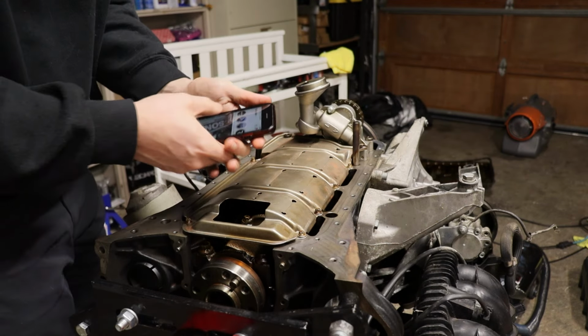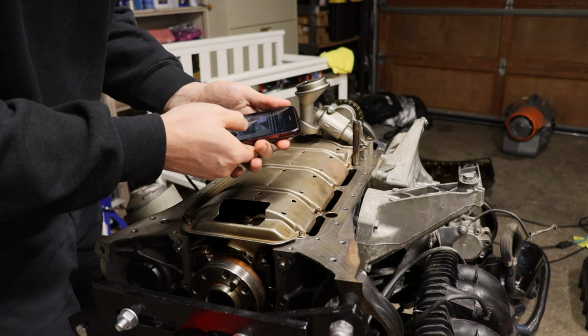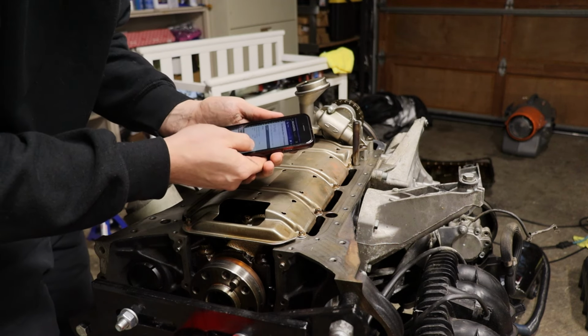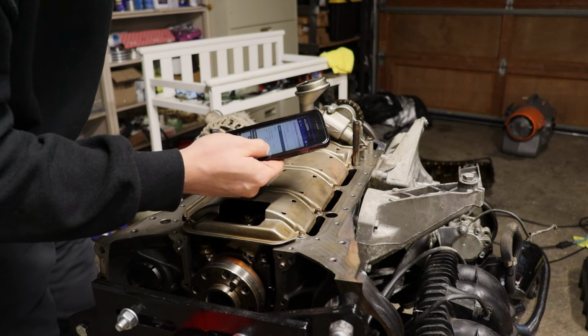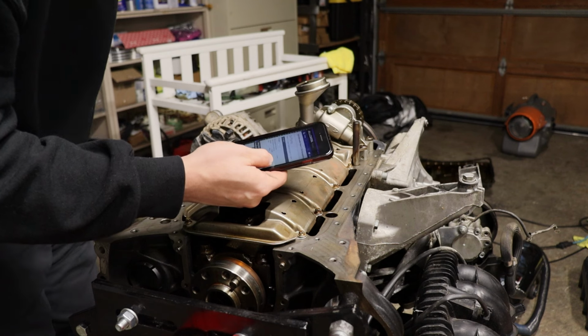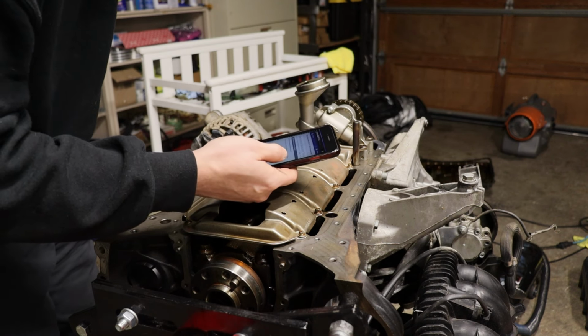Okay guys, now torque specs for these. I actually posted them on my story, because it's just an easy place to put. So, oil pump to crankcase for hexagon bolts, 25 newton meters. For Torx head, like we have, 18 newton meters. So those will go 18 newton meters.